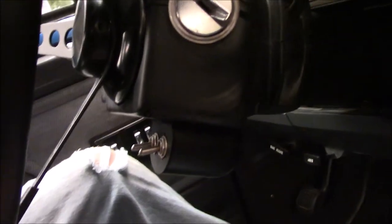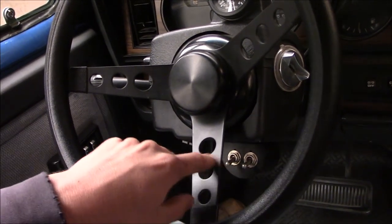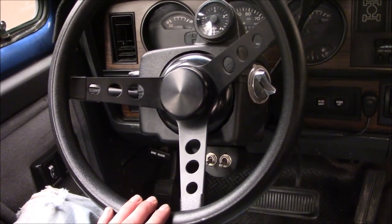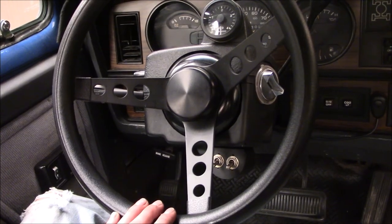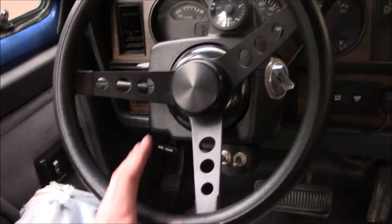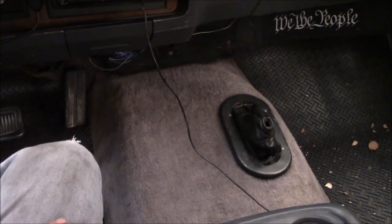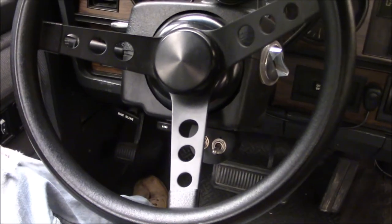Here's how it looks from the driver's seat. My little pod is set up down here — it actually turned out pretty clean. The one on the right controls overdrive into fourth gear, and the left one controls the converter lockup. I really hope I don't regret going the built automatic route — time will tell if it's durable. I kind of wonder whether I should have put an Eaton Fuller in instead. I'm really happy with it for now. I still have a few things left to do, like figure out the transfer case linkage and front driveshaft spacing, but I'll save that for a later video. Thanks for watching.